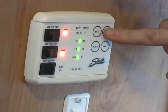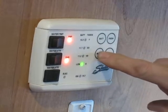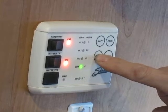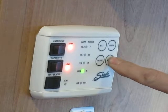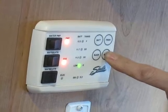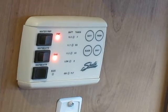The fresh water tank — I filled that up, but we tested the system a little bit, so it's about two-thirds now. The black tank is going to be just your toilet water — that's your waste tank for the toilet. And then the gray is going to be your sink and shower water. When these get full all the way up to the full line, that's when you're going to want to dump your tanks.